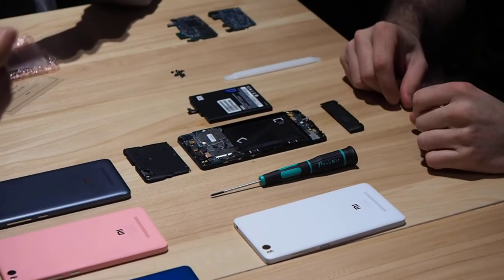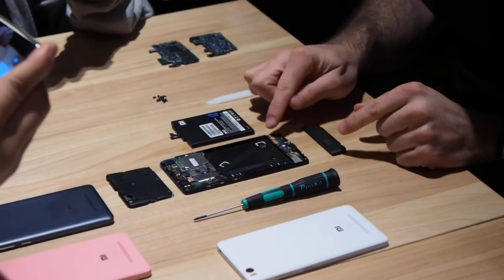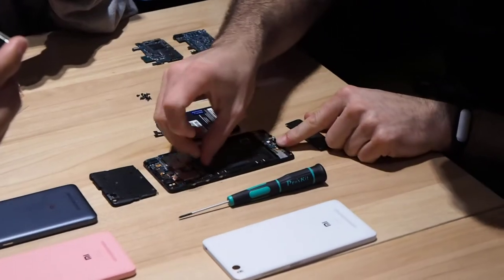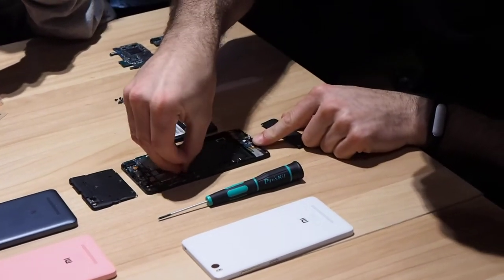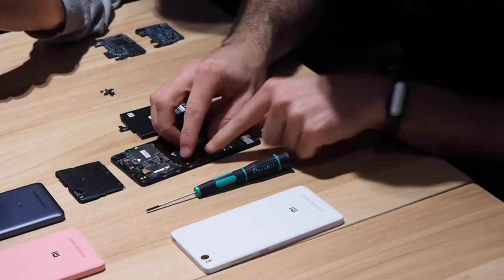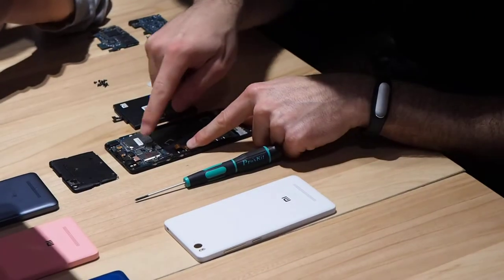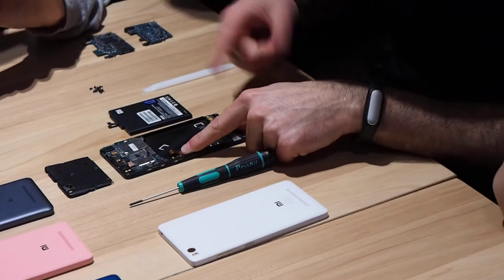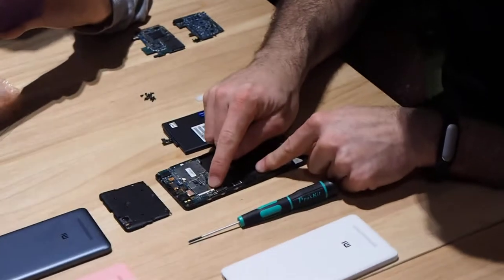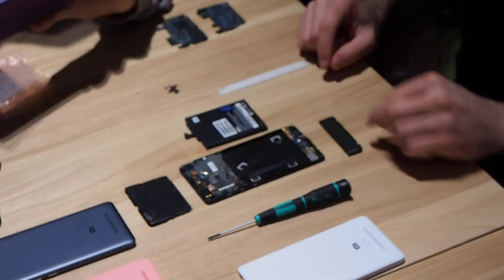Therefore, you need a secondary PCB. When you make a secondary PCB, you're of course spending more money because you have to make this separate circuit board. But then you need these connector wires, right? And these are actually very high quality wires with quick release connectors. You can see how detailed they are. So these two wires, which attach the bottom and top PCBs, are themselves probably about $1 to $2, right? So these are not cheap wires. Normally, you would actually see these components just soldered. We use quick release connectors everywhere.